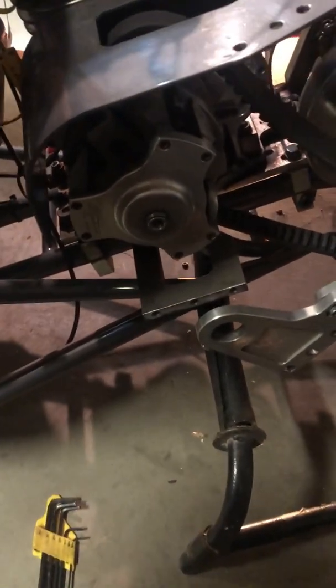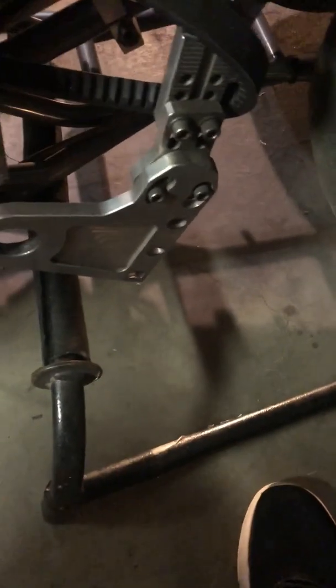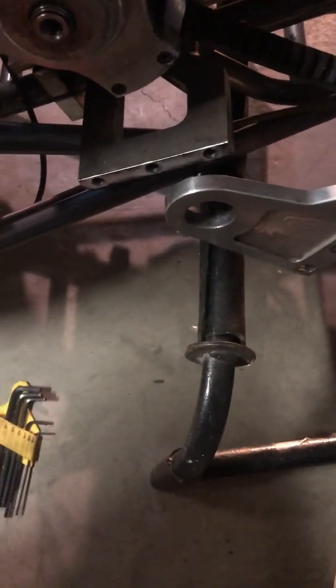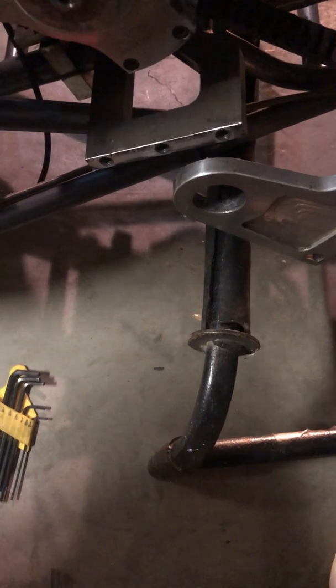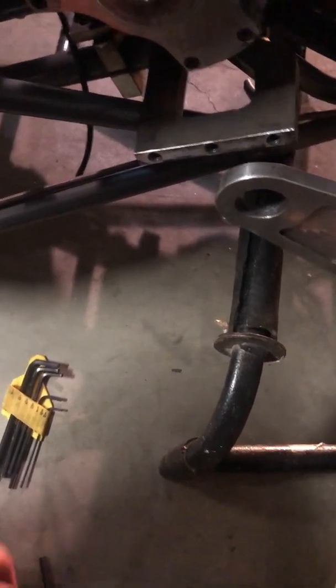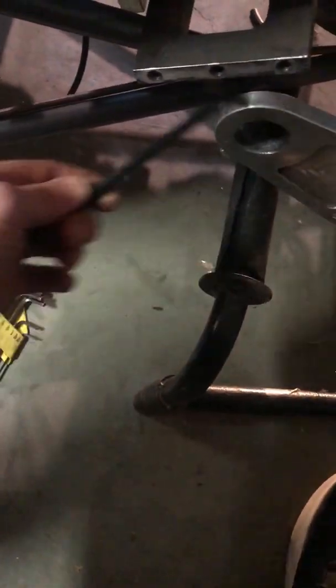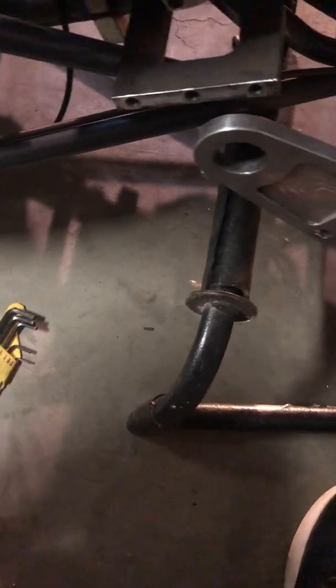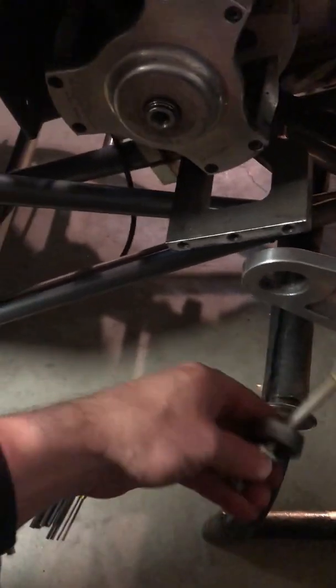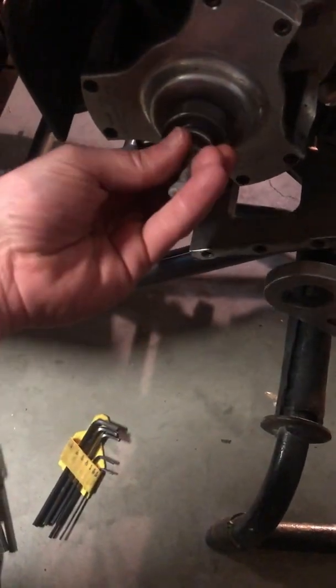And so anyway, the bolts that bolt on right there, I believe they're not metric. Thank God. I know everything seems to be metric anymore on most vehicles, but that's a quarter, I believe. So your quarter Allen wrench should get those three. I dropped those three, took the bolt out. It's a 1/2-inch bolt that goes into the bearing that holds the motor, the second motor plate, whatever you want to call that thing, and holds that on there just like that.